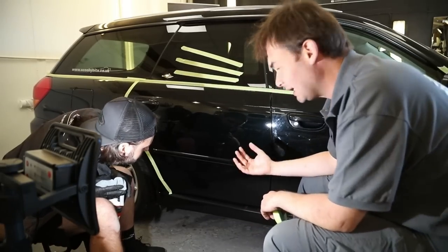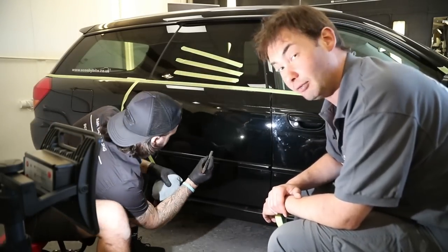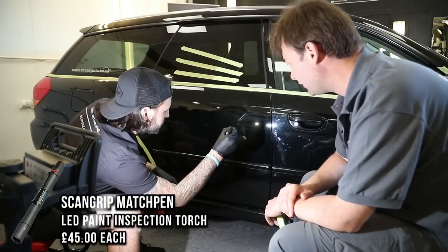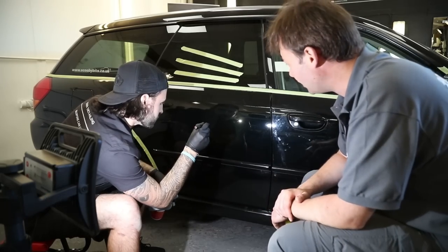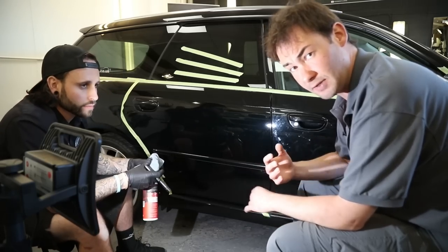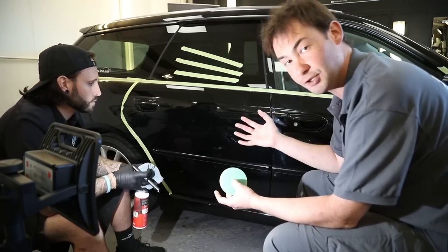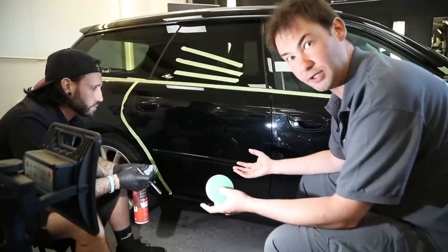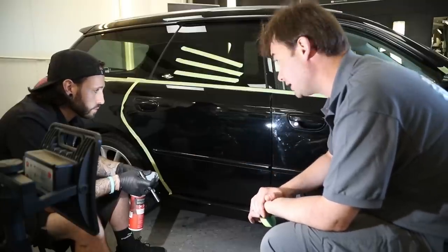You'll find detailers spend a lot of time making strange grunting noises while they look closely at paint — they're really looking for faults. And here we have a ScanGrip Gen 2. They do a range of LEDs and brought out a new generation — this is the pen. The idea is it's full spectrum, so it gives a broad range of frequencies, because sometimes your car can look great in a garage, you wheel it out into sunshine, different frequency, and all of a sudden you see marks that weren't there before. Well, I'd say that's a clean bill of health.